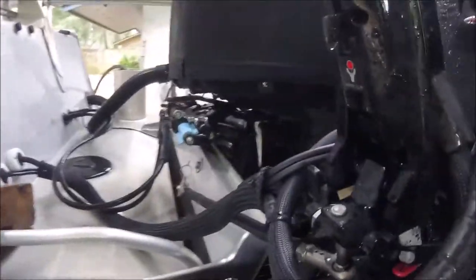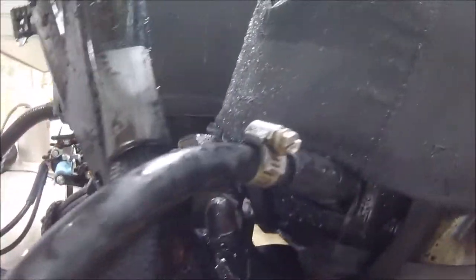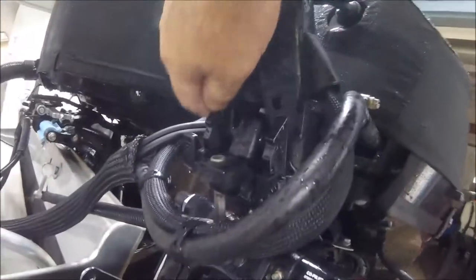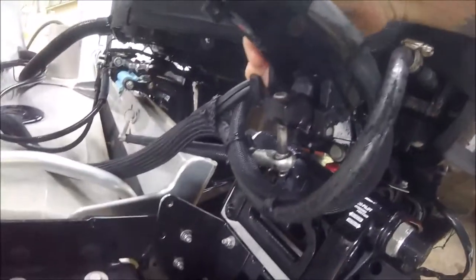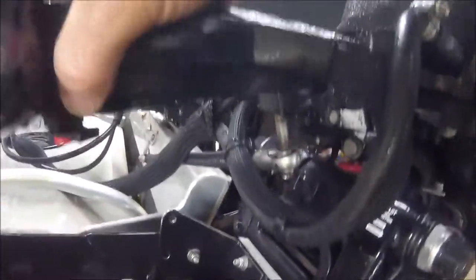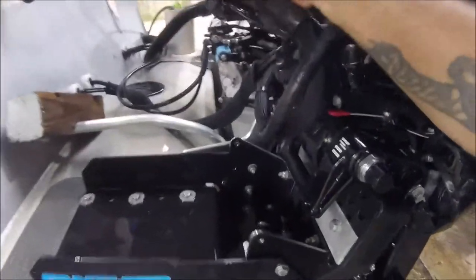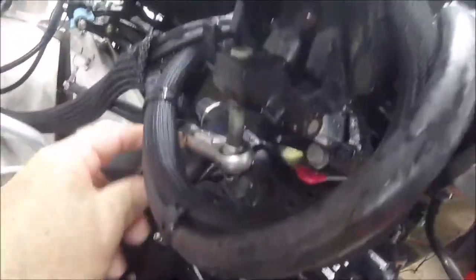Here's how everything works. Here's how I did my steering arm. That pin right there used to be for the lever. You flip this lever back and put this down at different levels on the tiller. See how it comes down — now it's coming down so low. What used to be in there was an adjustment screw, and what I ended up doing is putting this bolt through there.